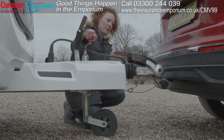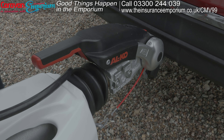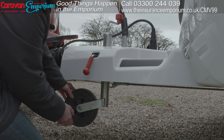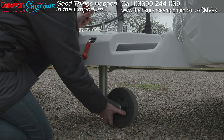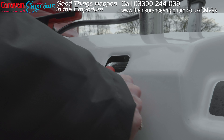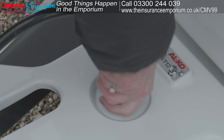This is the notch here — you need to manually guide it up. Take it slowly, loosen the clamp here while holding on to the jockey wheel, then turn it round and lift it back up. You want to tuck it out of the way and then pop the clamp back on so it doesn't drop down while you're towing.